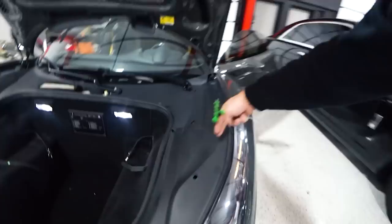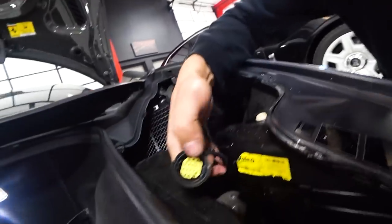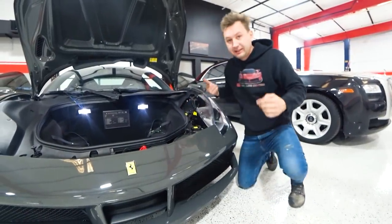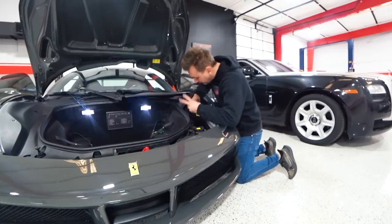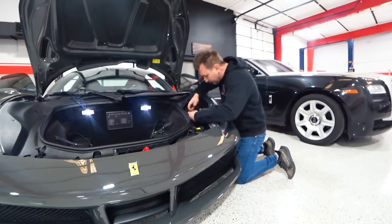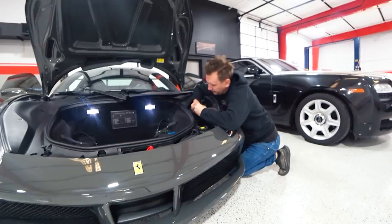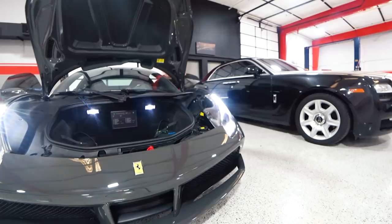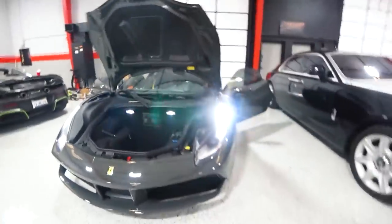Actually two of them — two lower ones were disconnected. All of them look good now. It works! Now it's perfect. Before I checked it out, I didn't know it was going to be a connector problem, but from my experience it's usually like that. People think maybe it's the headlight and they buy a new headlight from the dealer — like $5,000 — and then it's not the headlight.